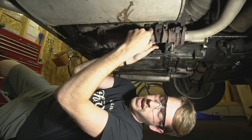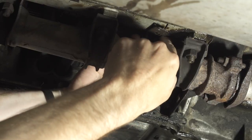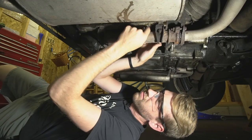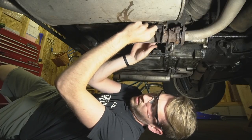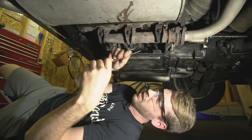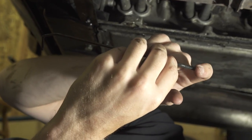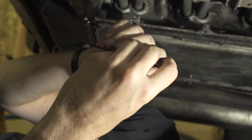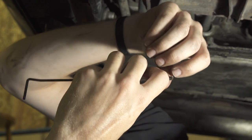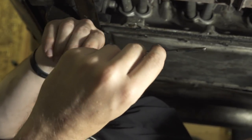What I'm doing here is disconnecting the rod that transfers up through the cylinder head. If I can get this rod out, it's going to allow me to replace everything without having to remove the exhaust. We'll pivot that rod out and see if it's even in usable shape. This is the rod that hooks into the bi-metal coil down on the cylinder head and then threads into the rod that attaches to the carburetor. But on this one someone has really boogered it up — it looks like they broke the rod off in there and then tried to cut a slot to get it out. Definitely not usable, but fortunately we ordered one and I've got a replacement sitting on the bench.